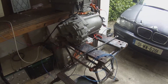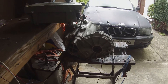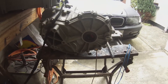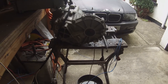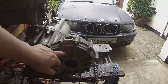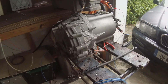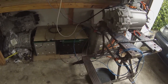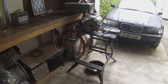I was doing some spins earlier and had to put some oil into the gearbox. Because I don't have the half shafts installed, the oil tends to want to come back out, particularly when we get up to higher RPMs in reverse. So I won't be doing much reverse and I don't want to go too high on the revs because the spider gears start to bang around inside the case — really don't want something bad to happen there.